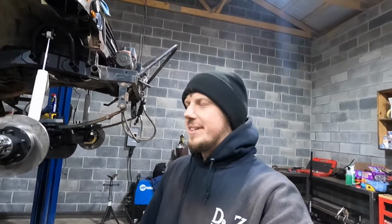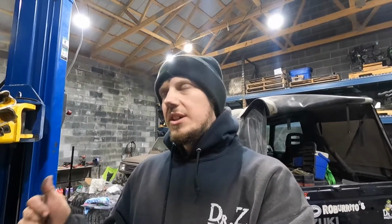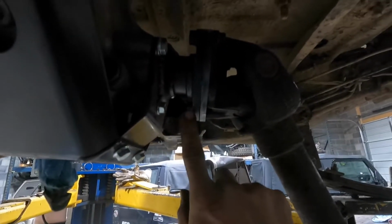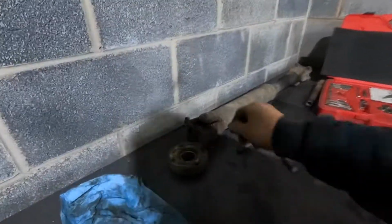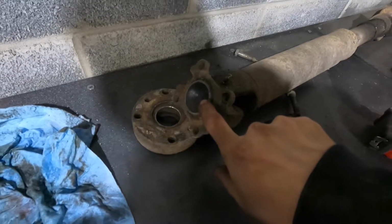Okay, so it's Monday night. Today was a super hectic day. Felt like I didn't get anything done. But for the flanges for the drive shafts, I'll just get into it. So here we go. Toyota drive shafts' bolt patterns are the same as the Samurai large flange. They work, but on the drive shaft, this round part is a bigger diameter than the Samurai flange.